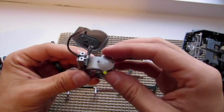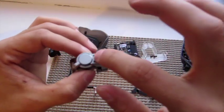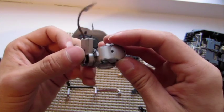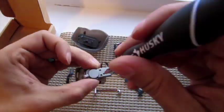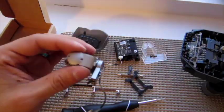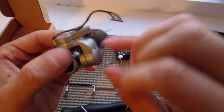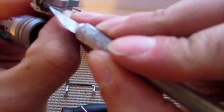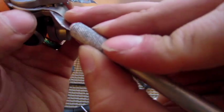I'm going to remove the broken bracket for the stabilizer that broke. We need to take this entire assembly apart to get at this ribbon cable. I'm going to take off these screws in this order: first these two screws to remove this cover, then this screw, and then one, two, and three screws. This piece right here is all one piece and needs to come off, so I'm going to use an exacto knife very gently to pry it open enough to get my fingernail in and pull this cover off.